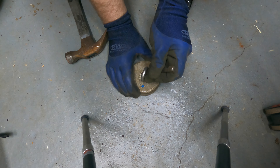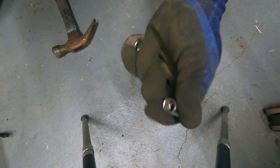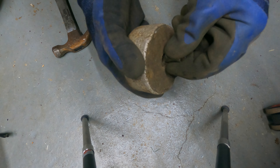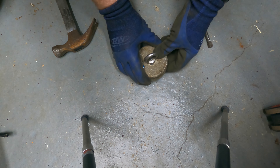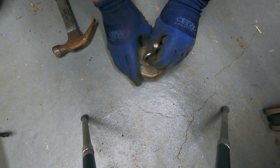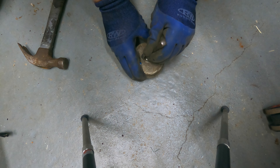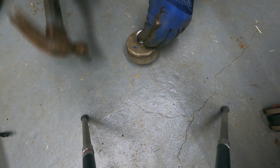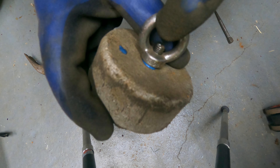It's kind of hard to show with the camera angles I have. Put the nail punch in there, grab your hammer — as I said, it's magnetic so it's going to stick. Just give it a good tap. It usually pings that over. You can grab a 10mm socket — quarter inch — it'll slide right inside that hole. Set it down flat, put your punch right inside there at a slight angle, give it a good hit, and bend those threads over so it can't come out. Now you can see it — it dented the threads. Makes it a lot harder for the eyelet to come off.